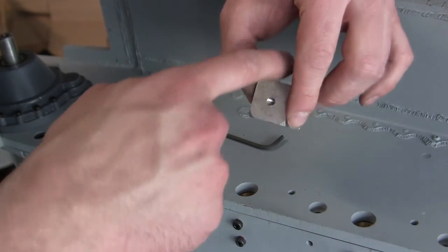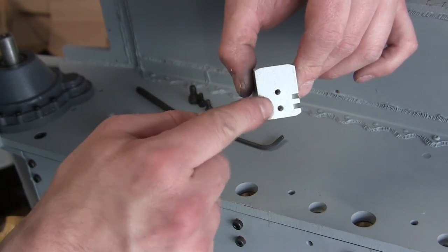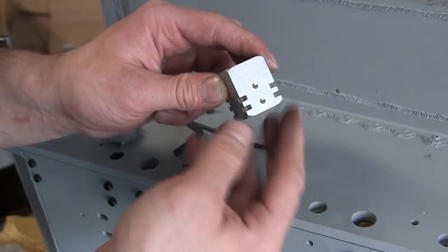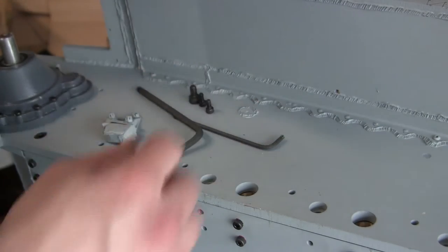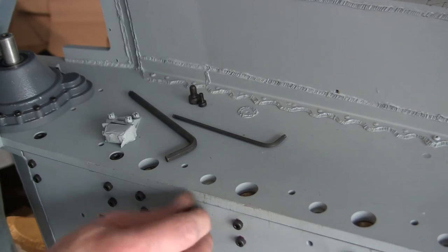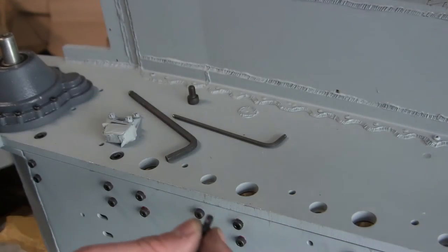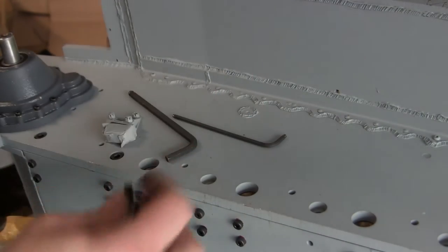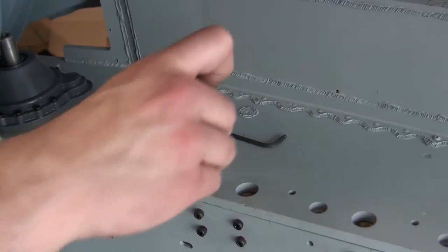Since this block is also used for mounting of the torsion bars, there are two sets of holes that are pre-drilled and pre-tapped. To identify the two: the two holes that are close together are facing up as this is the actual mounting location for the torsion bar locks, while the two widely spaced holes on the bottom are used for the actual fasteners themselves. For the installation, I already have some Loctite pre-applied to the fastener here and I'm going to thread it in. I'll add a little bit more Loctite to this one as well and then install it.